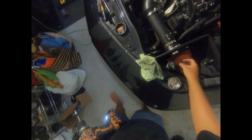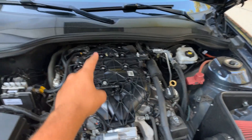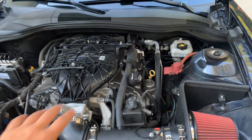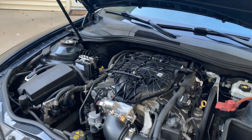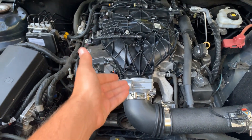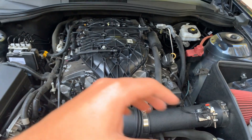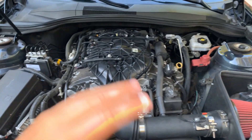The car is pulled outside — the ported intake manifold by Kenny Roberts and the 80 millimeter throttle body by Overkill are both installed. Everything is running perfectly. On startup, the idle will be rough for about 20 to 30 seconds — that's just the computer relearning a larger throttle body. It's not used to having that much air. An Overkill tune would help speed up the learning process; it could take up to 200 miles to fully smooth out. The more I drive it, the smoother it's becoming.